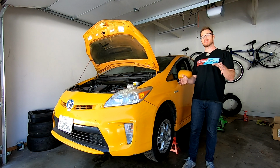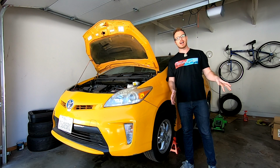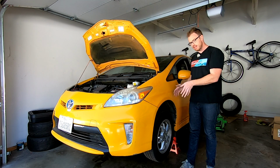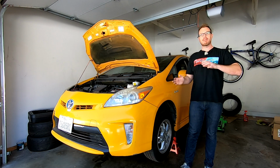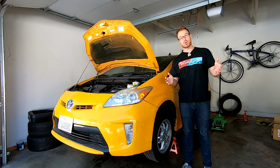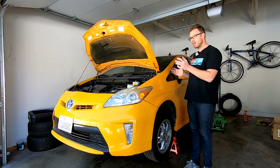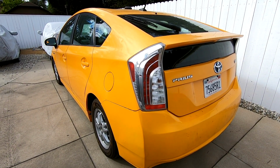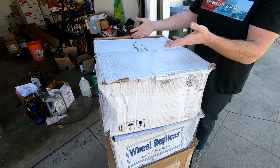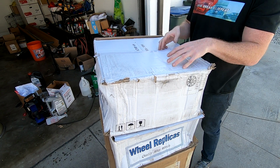However, there are also racers who think the exact opposite. Some people say it is impossible to over-tire a car. If the tire can fit in the fender, it is just the right amount of tire, because you'll more than make up any differential in acceleration in the corners. And this is going to be an extreme case study, because this is the lowest power car at any given track day, and I'm about to put a lot of wheel and tire under the front of this thing. Now, Corvette-sized wheels and tires aren't exactly going to fit under the Prius fenders, but hopefully these do.